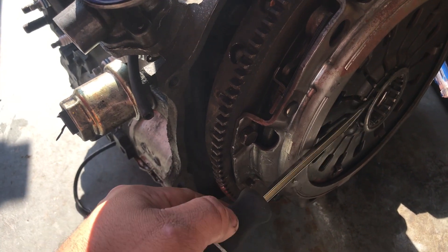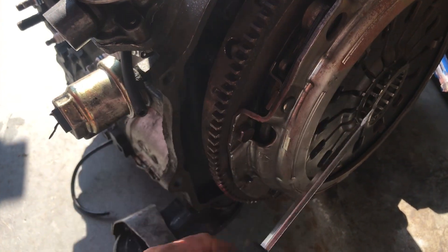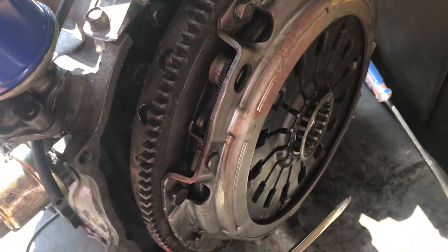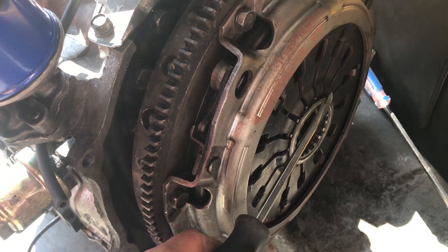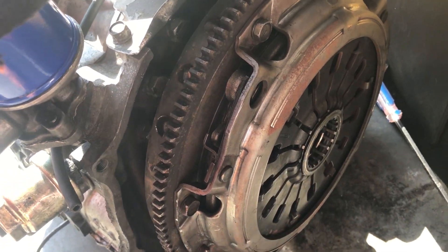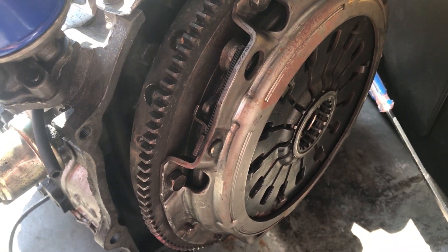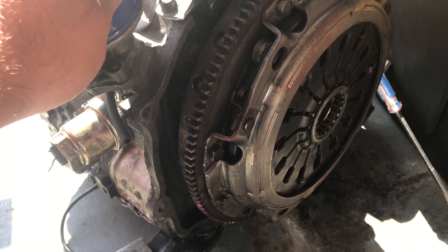When you're looking at it from underneath the car, the ring will be pulled out like this. What you want to do is push it back in — once it pushes back in, it releases and you'll be able to push it right out and pull the shaft right out of the car. That kind of got me for a little bit, but I just wanted to share that for anybody having that trouble.